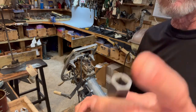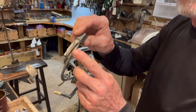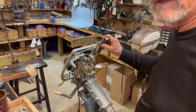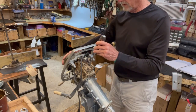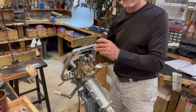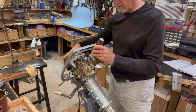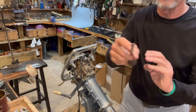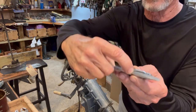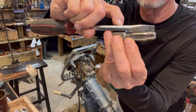The first thing we've got to make sure is that the piston inside is not at top dead center, otherwise when we're threading we'll hit that piston. I'm going to take a screwdriver, go inside and touch the piston head, then rotate the flywheel clockwise until it's at its lowest position. The screwdriver sinks in at the bottom — I've got this much clearance inside the hole and I'm only going to tap it down to that mark. The tap is well inside the depth of the piston head, so we've got a lot of clearance and we're good to go.